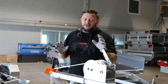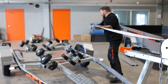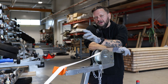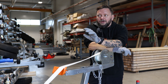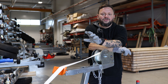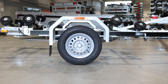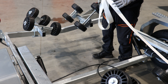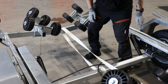Now that we have loosened up the axle, the next step is to hook up the winch to the axle. Please be aware that a little does a lot here — adjusting the axle by just five to ten centimeters can have a huge influence on the center of mass for the trailer. And in case you need to move the axle towards the back or away from the winch, there's a very easy trick for that.